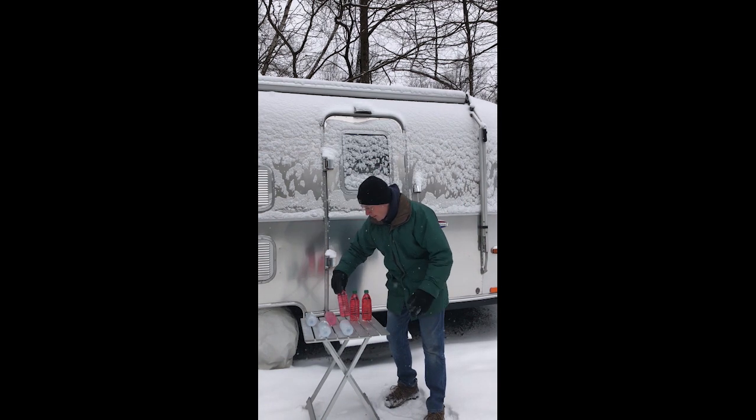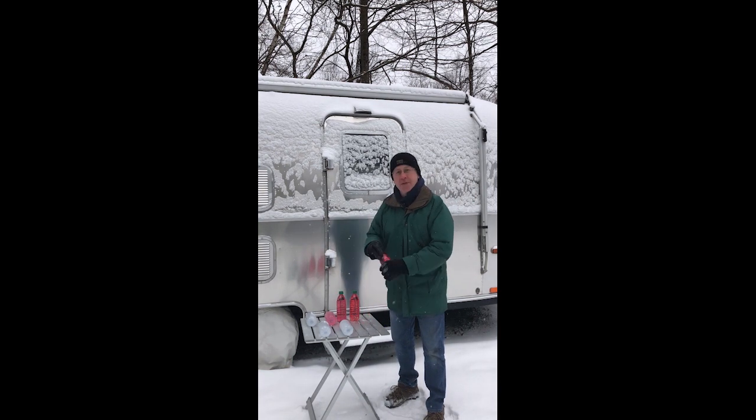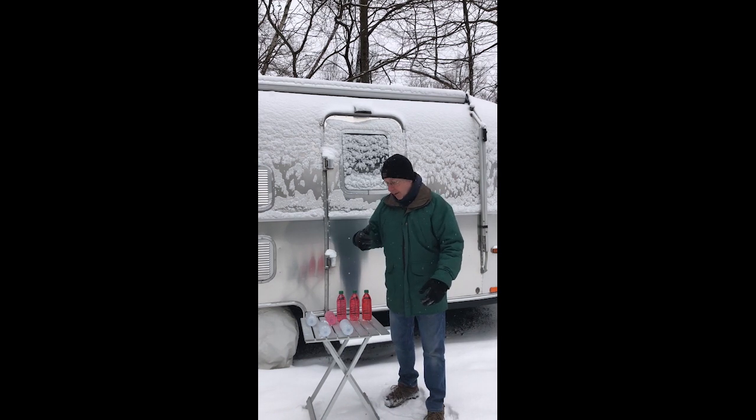However, at 50% we're completely liquid. Same at 75%, and of course at 100% it's all completely liquid. So even if you do get a little bit of water in there, having that RV antifreeze at least at 50% concentration is a good thing.